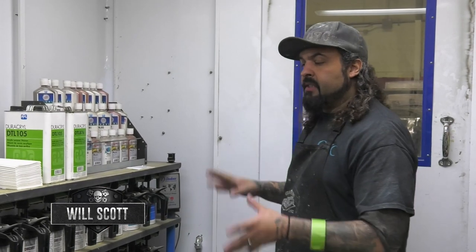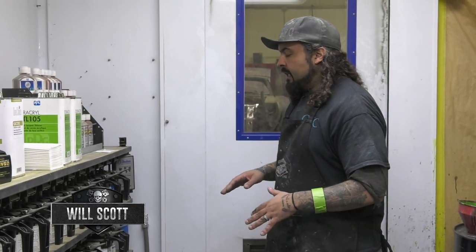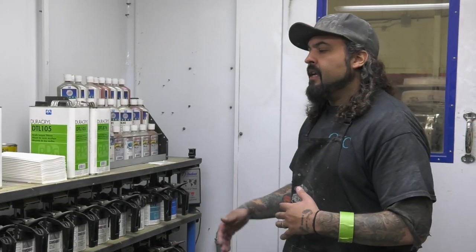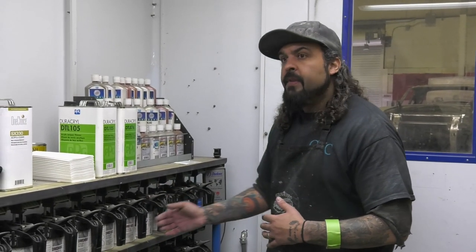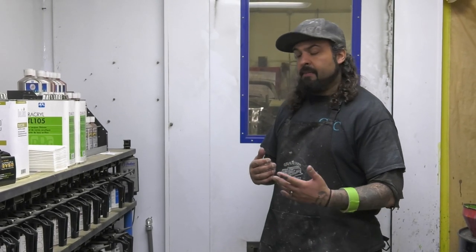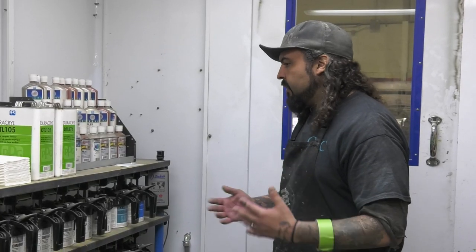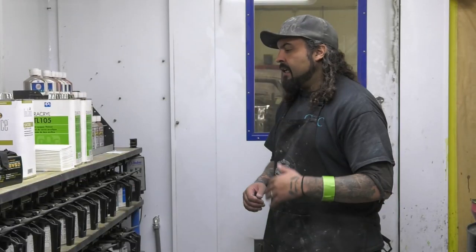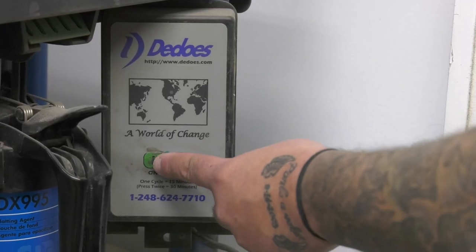So this is our mixing booth — it's a pretty standard one, holds about 60 to 70 toners. What it does is keep the paint stirred — if paint sits and it's metallic, if you don't stir it a couple times a day, that metallic will drift all the way down to the bottom. When you pour it, it's not a clean pour because you don't have it mixed up, and once you do that, that toner is ruined. So we've always done it twice a day — first thing when I roll in every morning I stir this, and then again after lunch. That way, every pour that I do is always consistent and correct.